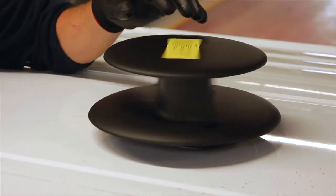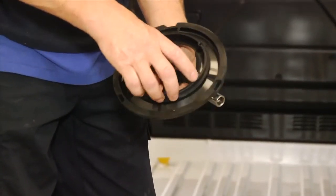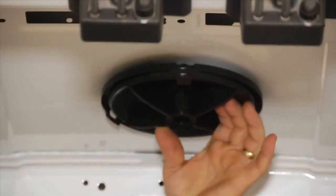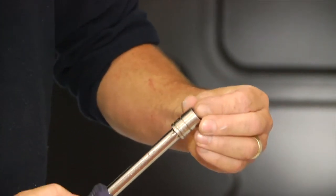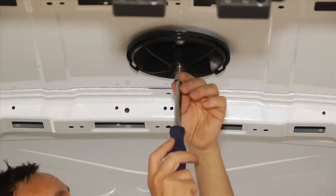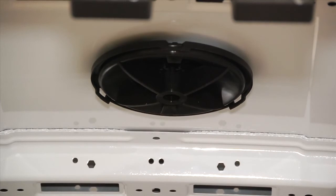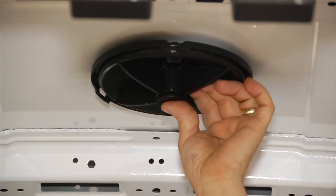Next, fit the extension ring to the clamping plate. From inside the vehicle, offer up the extension ring so the two locating pins protrude through the holes in the ring, and then fit the clamp plate, centering it on the steel shaft, taking care not to dislodge the rotor. Then, using a half-inch or 13mm socket spanner, fasten the clamp plate to the roof using the M8 locking nut provided. A torque wrench should be used to tighten the nut to a minimum of 2Nm. Finally, place the plastic cap provided in the central recess of the clamp plate, turning it as necessary to ensure it is pressed fully home.